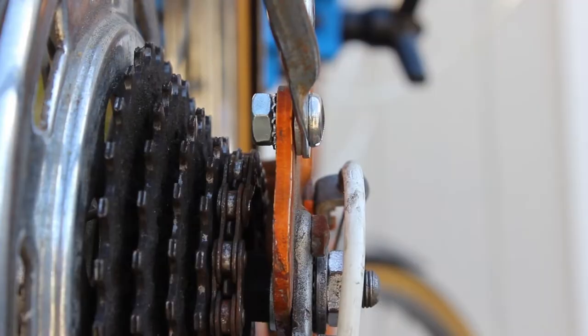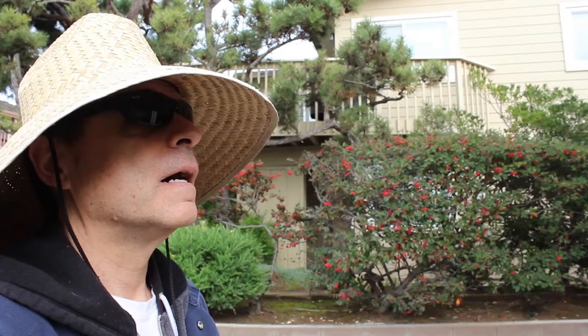One man's luxury is another man's necessity. Actually, having the correct rear fender brace hardware is important on these 5-speed derailleur bikes. Incorrect hardware can interfere with the chain when shifting to fifth gear. The narrow style nuts are an absolute necessity. Don't even think about it.